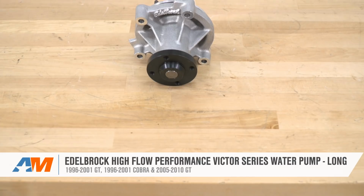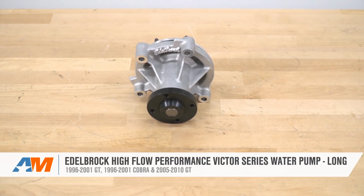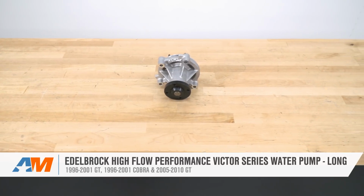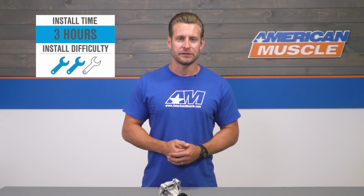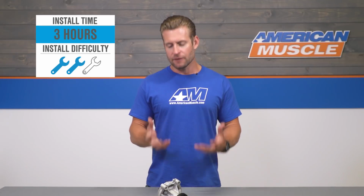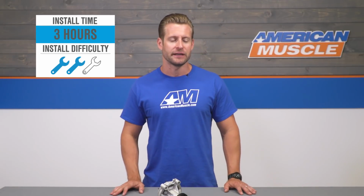If the factory water pump is on its way out in your 96 to 01 GT or Cobra or your 2005 to 2010 3-valve GT, then you might want to consider going with an upgrade like the high flow performance option from Edelbrock. Now this reverse flow pump will feature the long style body or shaft and will feature the upgraded cast impeller to improve your flow and performance for just south of $200. The site calls this job 2 out of 3 wrenches on the difficulty meter and a few hours from start to finish to get everything swapped out.